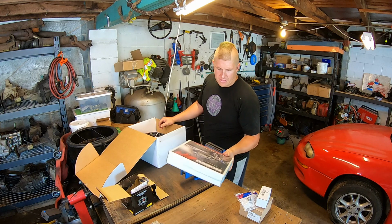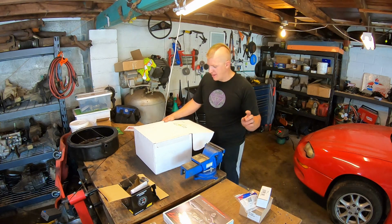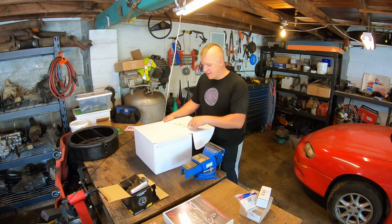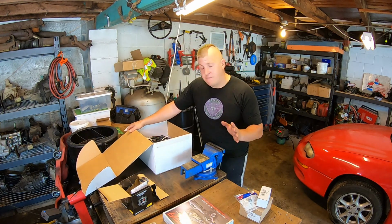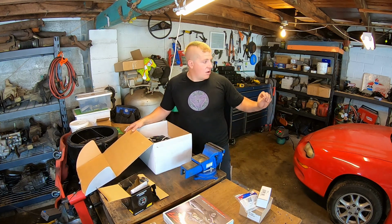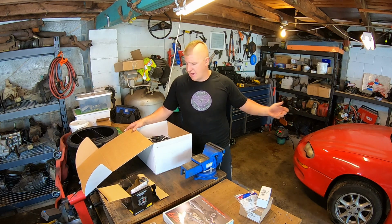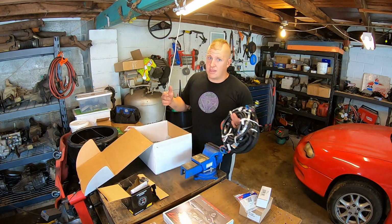The Holley Terminator X-Max. Now, this is the 550932 kit. It's for a 24X crank ring, EV6 style injectors. And this one will do drive-by-wire. The reason I chose this specific kit is because it will use most of what I already have. I already have EV6 style injectors. I already have the car set up for drive-by-wire, and it's a 24X ring on the crankshaft. So, for the most part, I should be able to plug most of this stuff in, and it'll work.